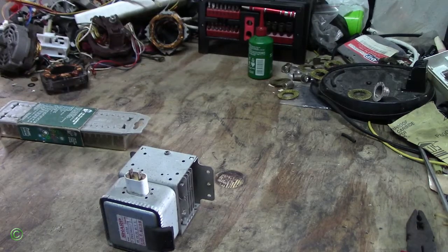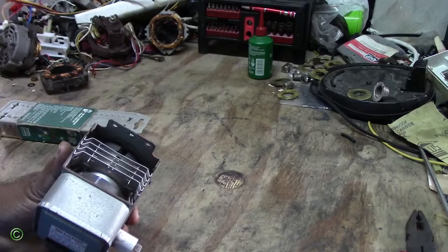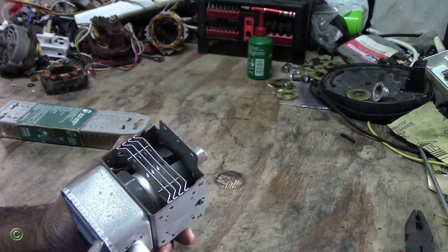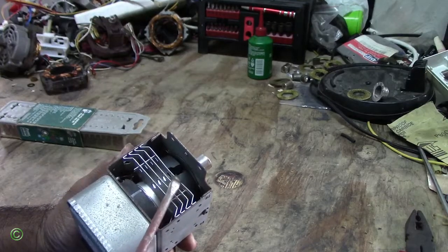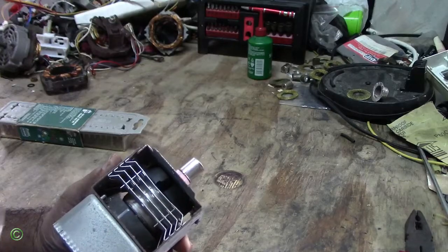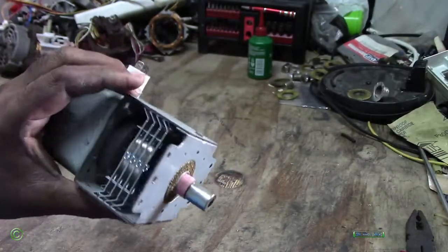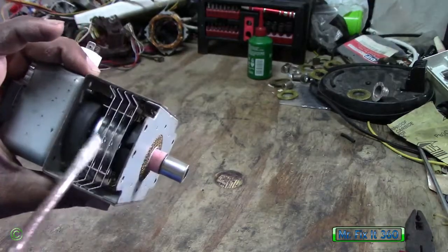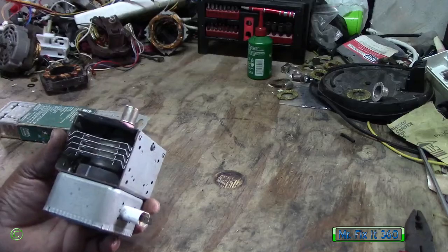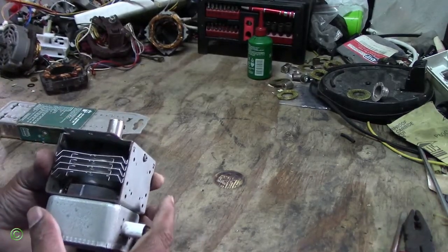So one of the main reasons why it does heat very low is because of this. If you can watch, you see a magnet there, it's cracked. So that's one of the reasons why it's producing a very low heat, because of the magnet. Right, how the magnet is cracked there, they're not producing enough, normal power. They're producing a lower power because the magnet is cracked.